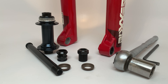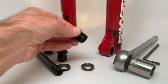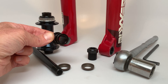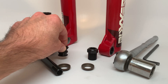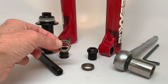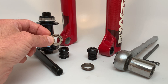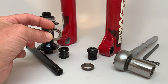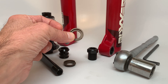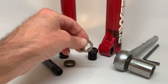The kit is made up of five pieces: your M20 to M15 threaded adapter, your through-hole insert which downsizes the non-threaded hole in your fork to take the 15mm axle, and two hardened stainless steel dropout inserts that protect the inside of your 20mm dropouts from the smaller end caps on the 15mm hub. There are also alignment shoulders on each insert to help center the hub when installing the thru axle, plus a small o-ring on the back of each to help retain it in the fork.